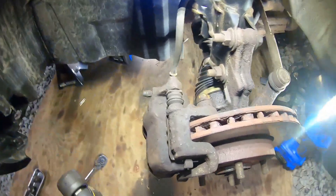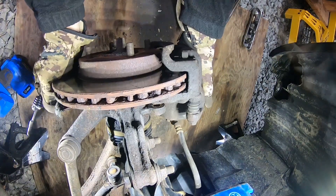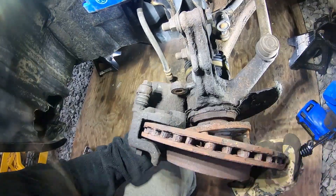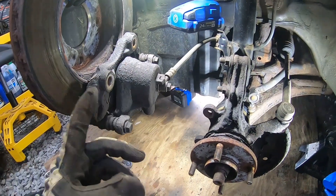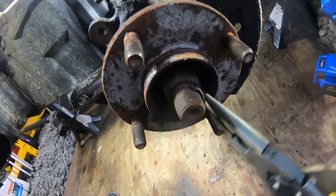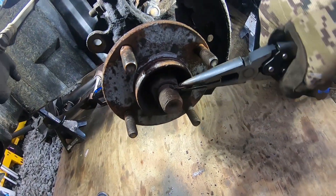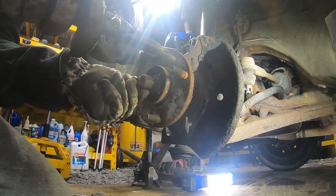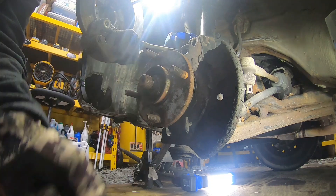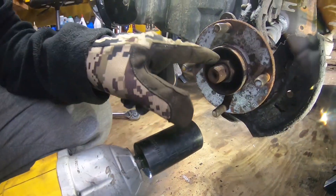There's one — let's get that top one out. Now we'll get a bungee and get the rotor and caliper up out of the way. You can release the pads in here to get it off the rotor — just take a screwdriver and press them side to side — or just leave the whole thing and slap it right back on. Go ahead and get this keeper out of here. Now let's go ahead and take the axle nut off. We've got a one-and-a-quarter — go ahead and take this off.